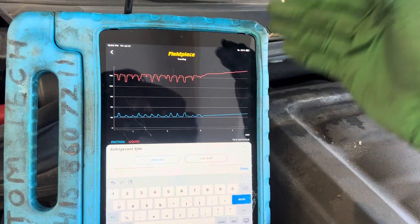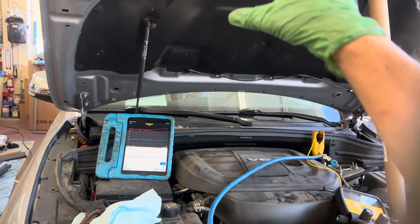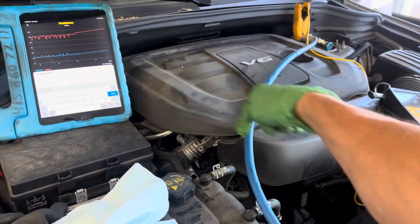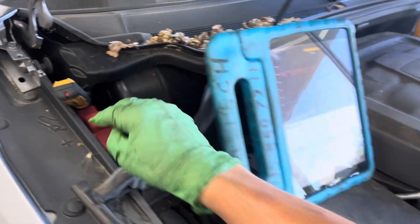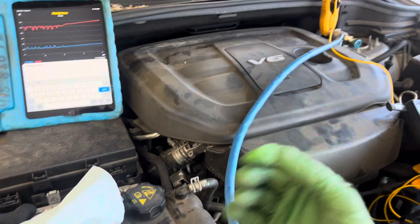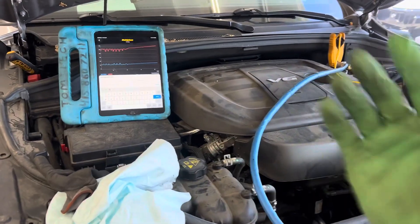That is the difference between recycle and fresh air mode. You have to notice when you have the hood up and it's 90 degrees or 110 degrees and you're in a desert somewhere really hot, and you put it on fresh air mode with the hood up — you're taking in like 200-degree or 160-degree air being fed into your evaporator. It was never designed for that and you'll get some really crazy pressures. And if you're trying to be one of those guys who do the little shake-your-can thing, trying to achieve some certain pressure, but you're feeding it 160-degree air across the evaporator, you might as well be pissing in the wind.